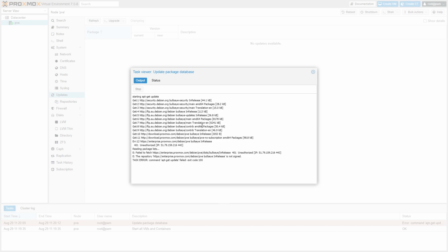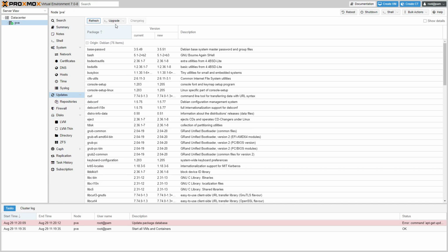All right, guys. I'm just cutting to this point. So we had a bit of an issue that I need you to be aware of. If you are going to try the ZFS array as a VM here on Unraid like we are, you might come into an issue that we've just experienced, which was it couldn't import the array. And a bit of searching around reveals that because it's on a cache that is SSD, which I'm sure most of you do have set up as well for your virtual machines to put the vdisks on your cache, apparently the cache SSDs can be too fast.